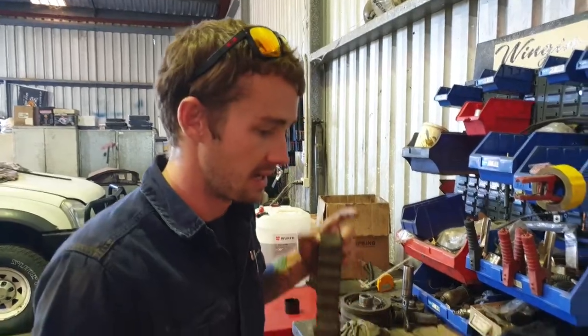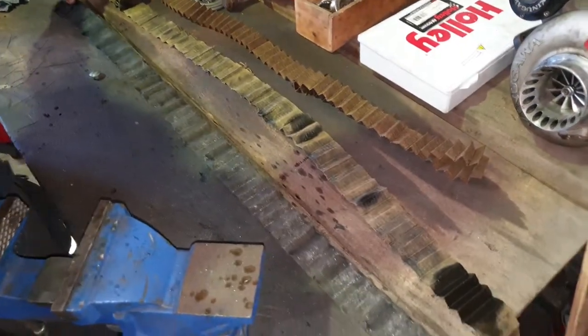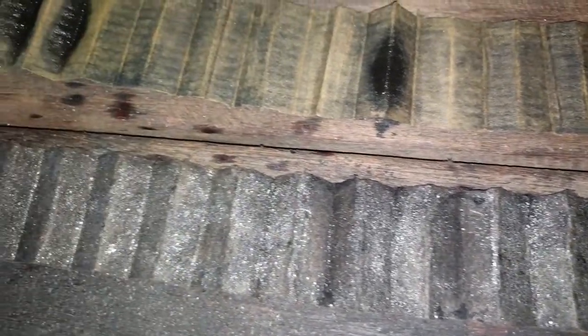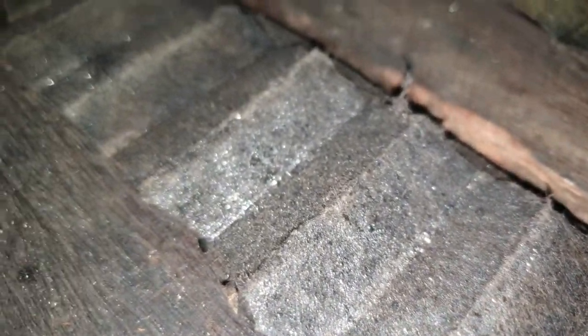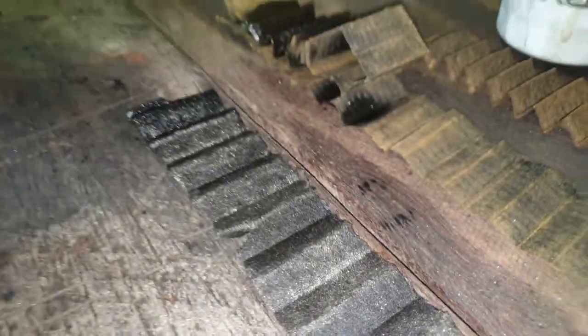This is the actual filter out of EcoBoost after that bearing failed. Have a look at them side by side. So the bottom one is an absolute glitter factory — all those shiny bits, all tiny bits of bearing, and there's even like a paste on there, man — it's turned into a freaking paste. Yeah, she wasn't well.